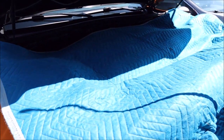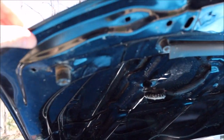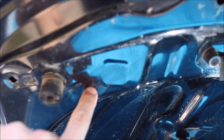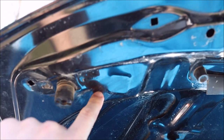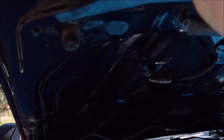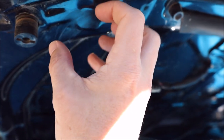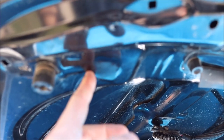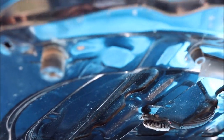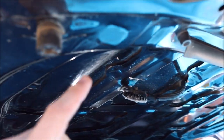Getting ready to drill. You do need some kind of moving mat because you don't want metal shavings in your engine bay, so set something out. I used my automatic center punch — probably won't show up on camera but I do have a hole mark right there. Then wiped off the toothpaste. It looks like there's a bottom layer of a two-layer hood, with the second layer being the top surface. I'm going to start with the inch and a half hole saw bit to make it wide enough to screw the bottom piece on, then use a regular drill bit to start the hole that actually pokes through the top of the hood. When you do this, make sure to keep the drill as perpendicular to the surface as possible — difficult since the hood is at an angle, but just be aware of that.